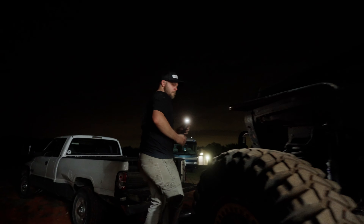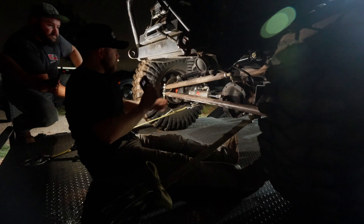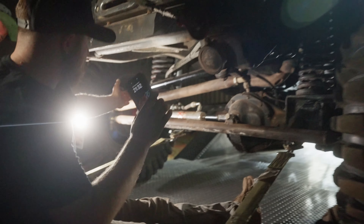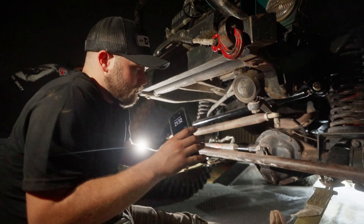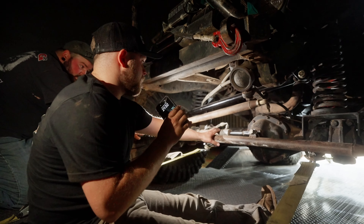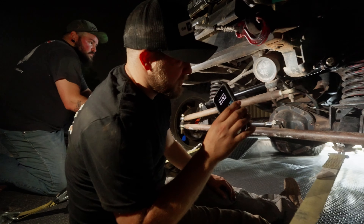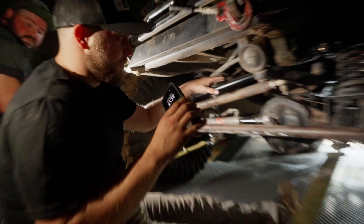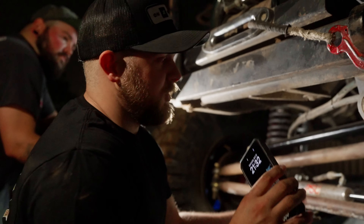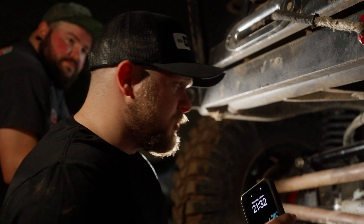Up front was a major upgrade. The track bar wasn't equal length, as you saw in previous videos, so we made a completely custom length track bar — it's all in the same plane as everything else. We rotated the ram back a little bit for hose clearance, so all the hoses are falling nice in line and the brake lines are not binding or stretching. We put this thing up and stretched it out earlier and nothing is binding up. Just from loading it on the trailer, I can tell the steering isn't fighting it anymore — it's not pulling the suspension one way or the other. It felt a lot smoother.